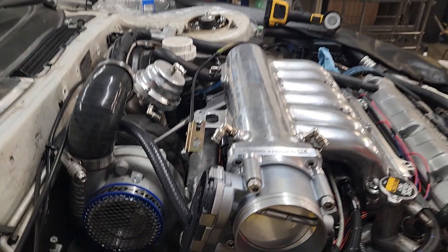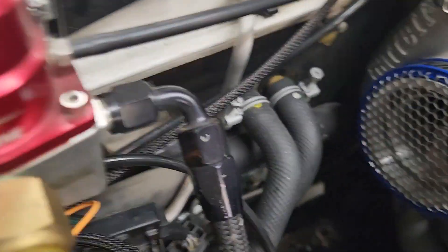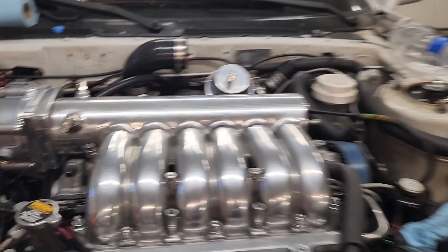We're not going to have the throttle cable anymore, so we're going to take all of that out. We won't have the big cruise control motor down there, and we also won't have the cruise control box, so that frees up a lot of space and really simplifies things. That's kind of part of what we're after — when building a car we're going to drive and race a lot, we want to have as few things under the hood as possible while still having everything work.